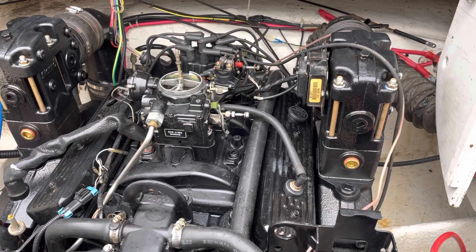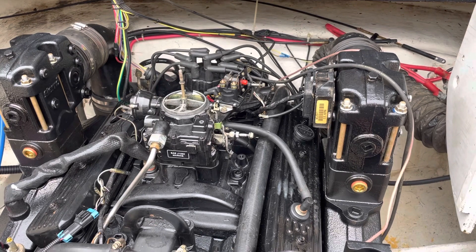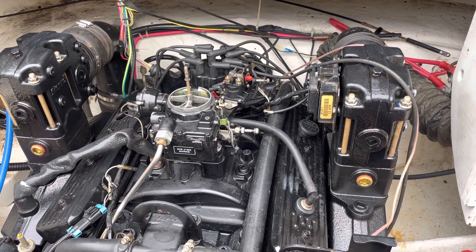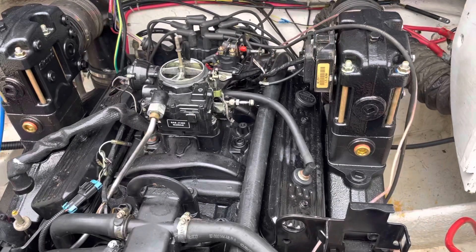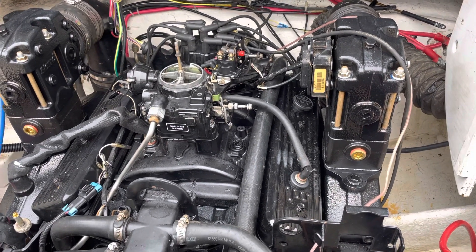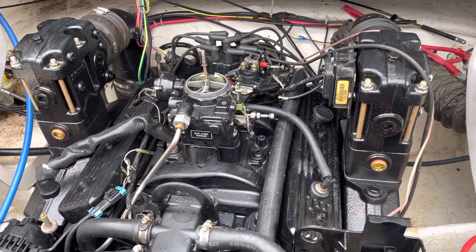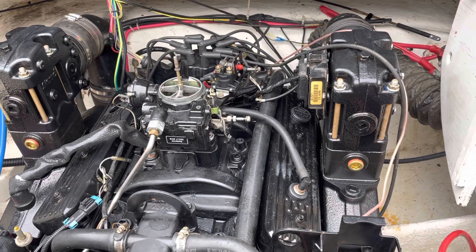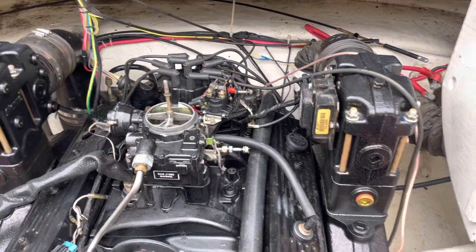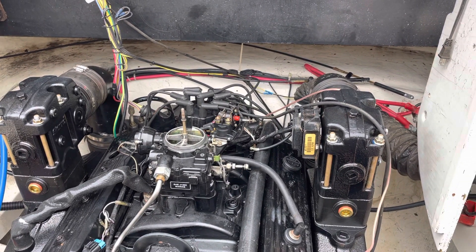So that's the little trick I used to overcome what I think is the weak Thunderbolt ignition system. If you have a Thunderbolt ignition and you're trying to get it to crank and you're having similar problems, run your ignition on a separate battery — it might help you out. I think the reason this is necessary is because this is a brand new motor, very tight inside — the rings are scraping on new cylinder walls that are still relatively rough. That takes a lot of torque and therefore current to turn a fresh engine over, which puts more load on your battery and drops voltage more than usual. So everything you can do to get as much voltage as possible on your Thunderbolt ignition module helps it deliver the hottest spark it can.